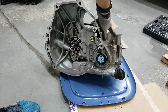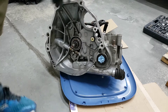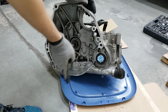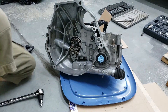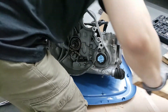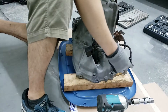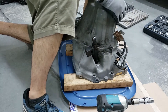Alright, here's the transmission. As you can see, this is the speed sensor — it's broken. Not cracked, but the housing bracket that holds it is chipped off. There's supposed to be a bracket holding it in place, but it's seized on there, which as I mentioned in a previous video is not uncommon. So I'm going to take this out and open up the case. First step to opening the case is removing this bolt here. Next I'll flip it over and sit it on some 2x4s — I'm doing this on a tray so it doesn't leak. In the Honda manual it said to remove this switch here too, though I'm not sure it's absolutely necessary.